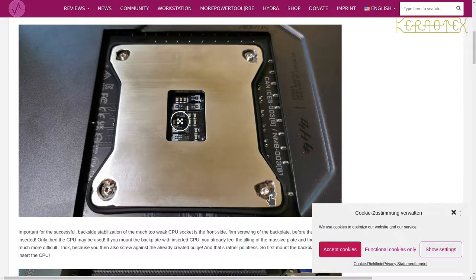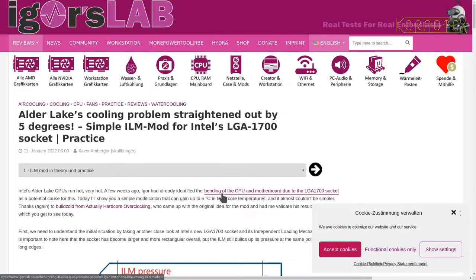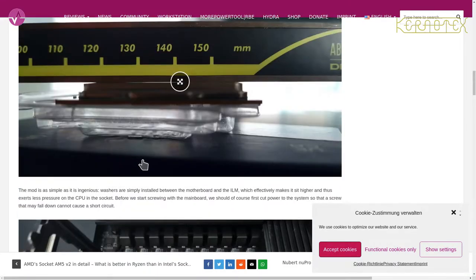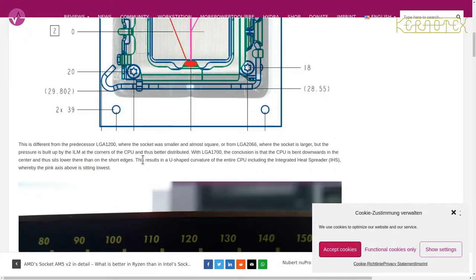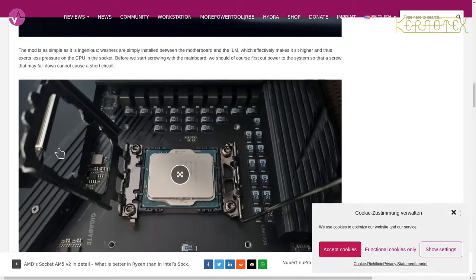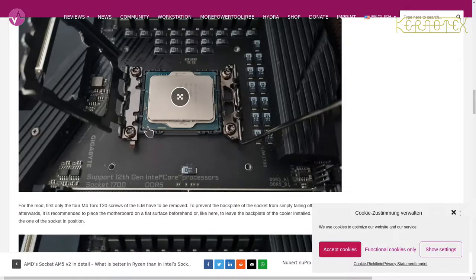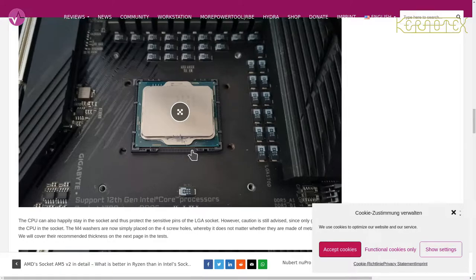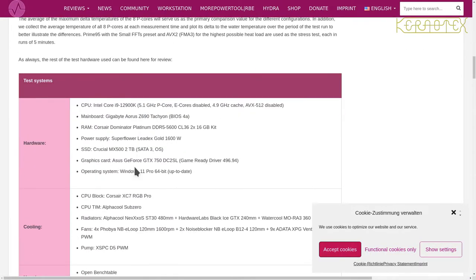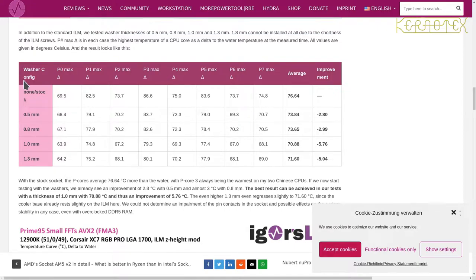There's another article that looks like it's created a custom plate mounted on the CPU, which shows the problem isn't just with one particular cooler — it's with several coolers. This website offers a potential solution involving removing what they call the ILM — the Independent Loading Mechanism — which is the bracket and the little flap that comes down. You can see from these pictures he's got it open and then completely removed it by removing the four screws.